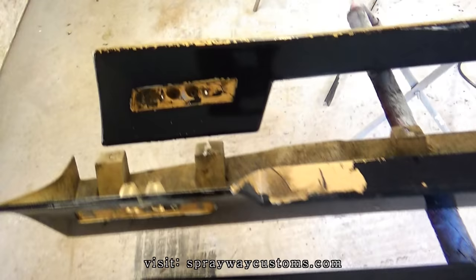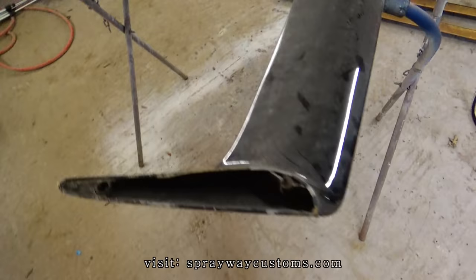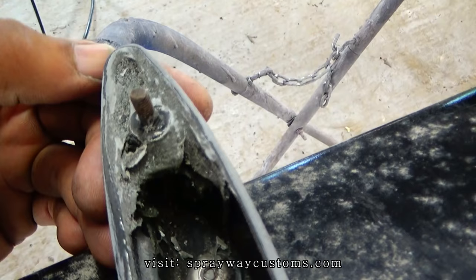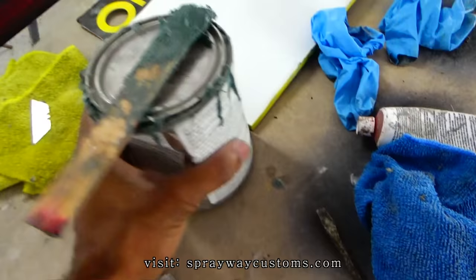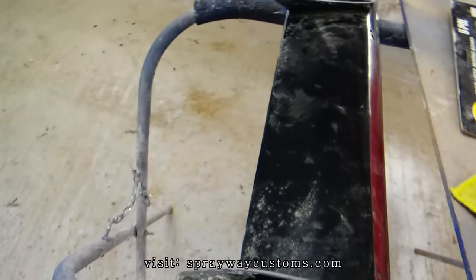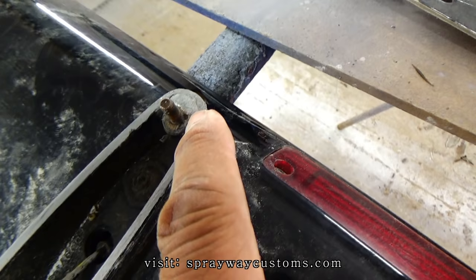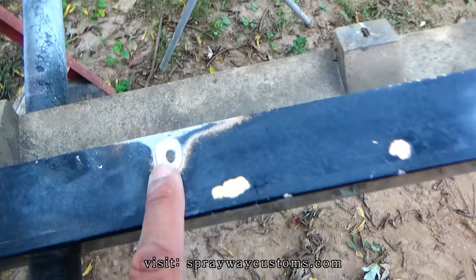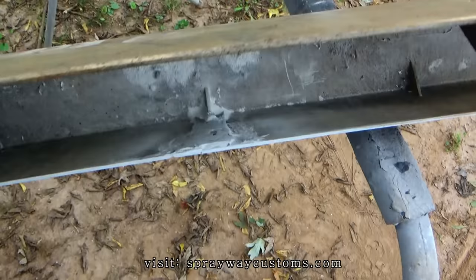I think the first thing I'm gonna do is prepare these pieces onto the spoiler. Finished up repairing the attachments on the spoiler. I just put some fiberglass filler, filled it up. I just used some bondo glass, repaired that one. This one, and this one here, put a little filler back there because it started cracking, and this one, and I also repaired the side skirt I got out here, repaired that one, and that one, you can see it from the back side.